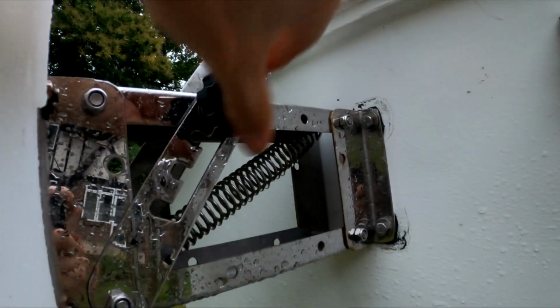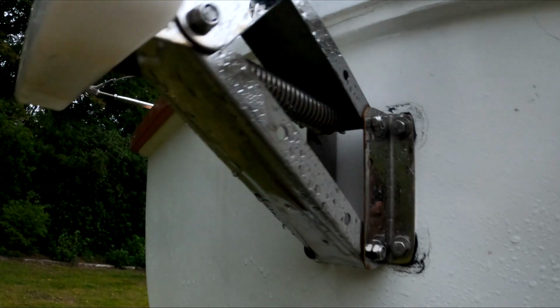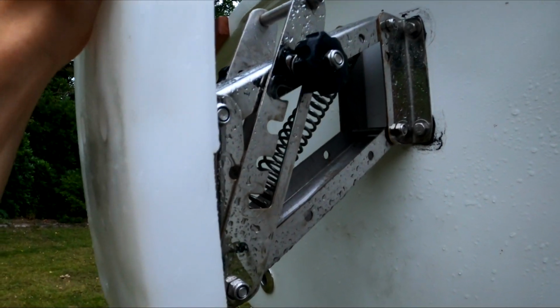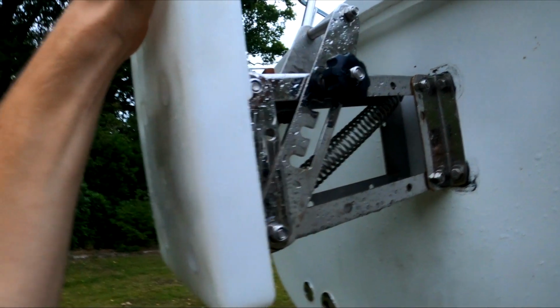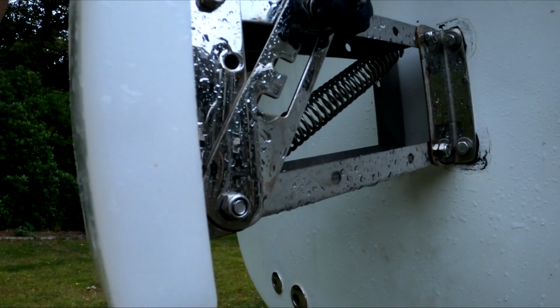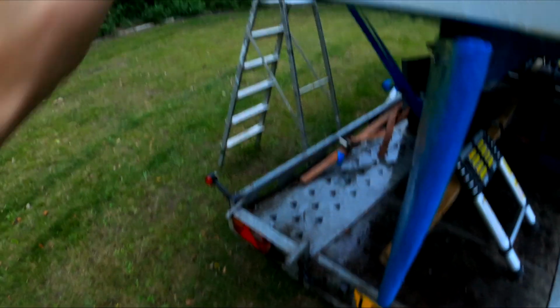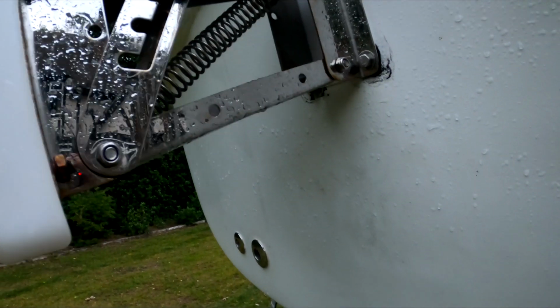But so you undo these two screws on each side, you can pull this back and then it's spring loaded, so you can spring it up and down and move the height of your outboard, which is good. So on the water, instead of having to tilt back the outboard too much, I think I have it on setting 2 for the actual, when the outboard's on there and I'm using it in the water. You can go deeper if you get in some waves, so you can lower it down another setting. And then you can just raise it up, probably go right up there. Then your outboard comes out above the waterline, and then you're not dragging. And all it is is those two screws in the handle, as opposed to having to try and tilt back your outboard while sailing along. So I think this should be quite a bit easier, and just tighten them up again.